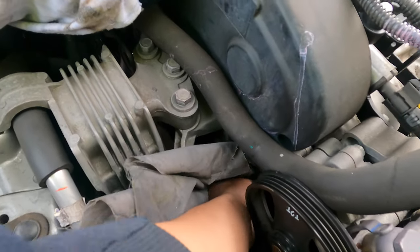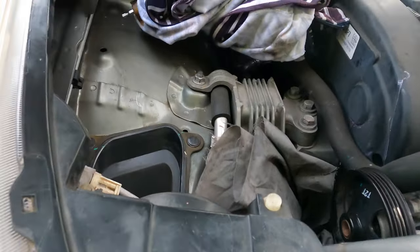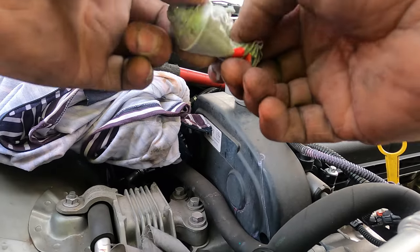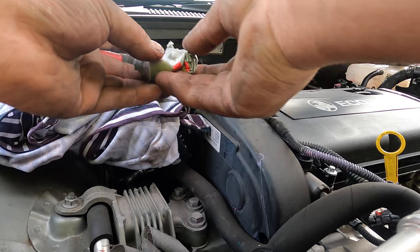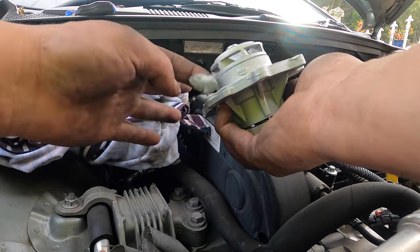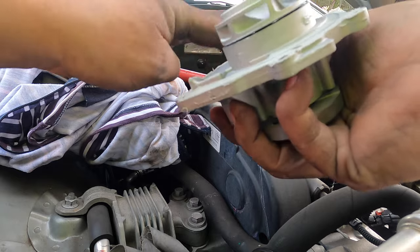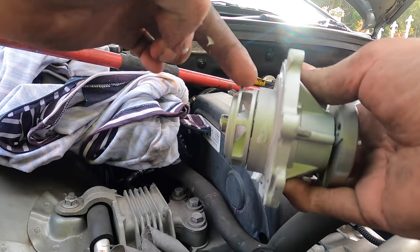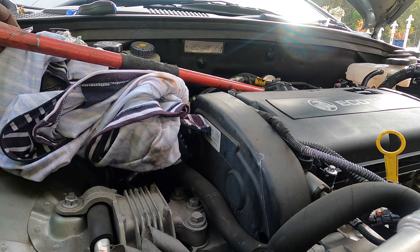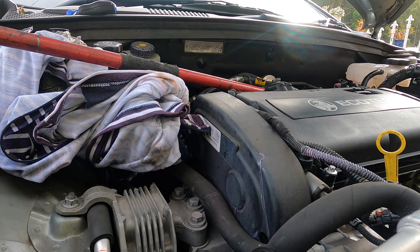The water is still coming out - put it in here and get it out from the hose there. While we're waiting for the water to come out, we take this one off and put a firm layer of silicone along here. Normally the seal is not coming out from here, but we still do it just in case we want to do a 100% job. Mainly the water pump leaks from the main shaft - nothing to do with the silicone here, but we're being safe.